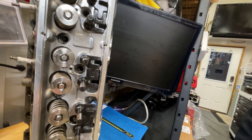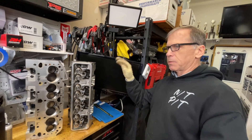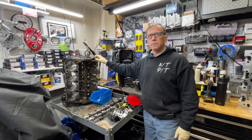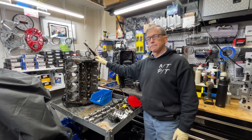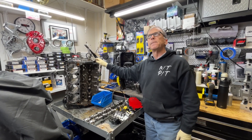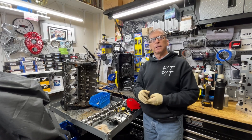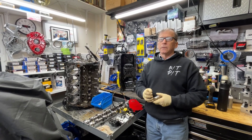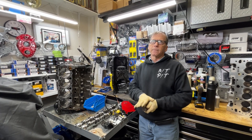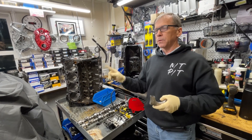How many minutes was this engine running on the dyno — 20 minutes, an hour? Warm up, make sure it gets up to temperature, 20 minutes. It gets very little run time. For guys that don't have access to an engine dyno — if you built the motor yourself, had the machine shop fit the bores, put everything together yourself — the first thing you're going to do is crank it, make sure the ignition system is working and it's not leaking. A 20-minute warm-up is not going to be a problem for ring seating.